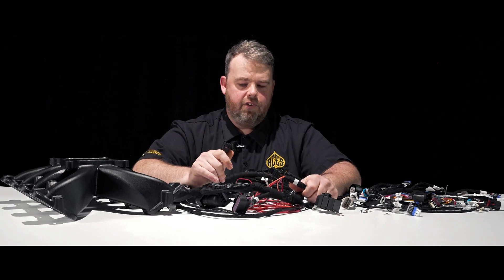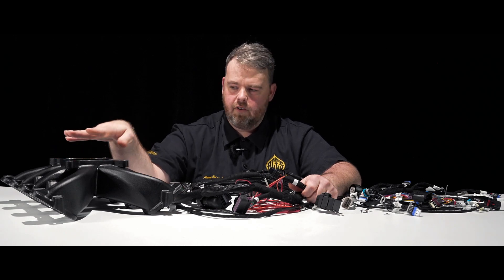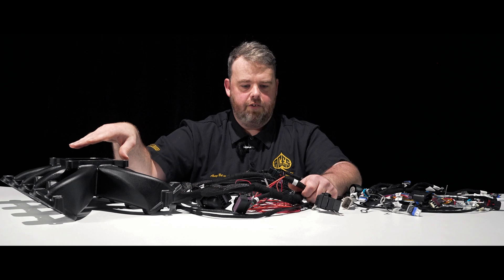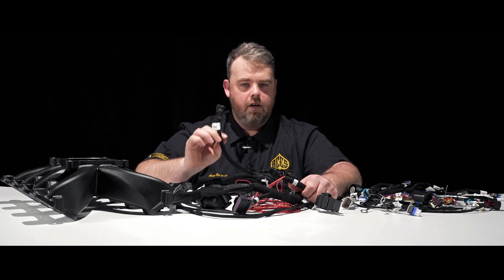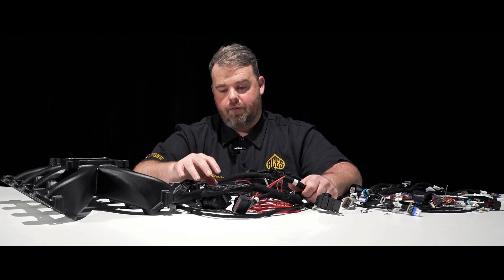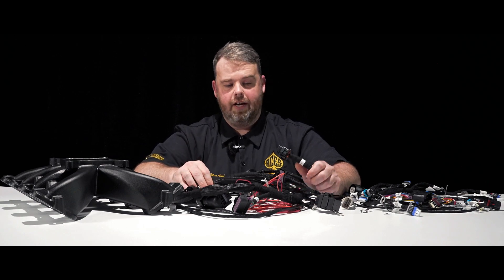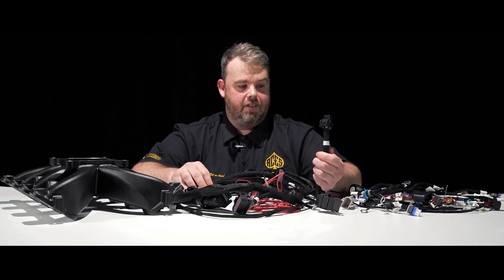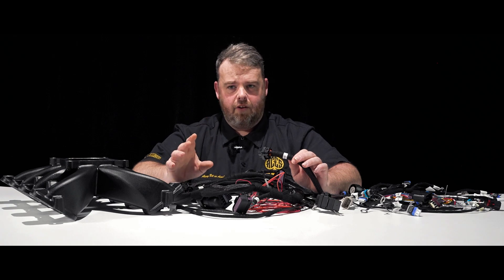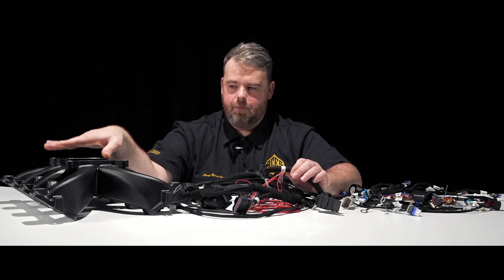This one's not going to use dual widebands because of how the fuel is applied to the engine — it's coming in the top of the 4150 flange on the intake, evenly distributing fuel to all cylinders. So we don't need to do a left and a right bank; we only need bank 1, which in a jackpot is the driver's bank. Or if you just choose one O2 sensor, it doesn't really matter. That's a Bosch LSU 4.9. The PIC connector is going to the throttle body — our kill-shot style throttle body, our ACES TBI unit, sitting right on top of this 4150 flange.